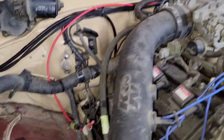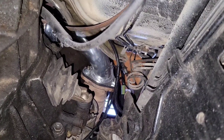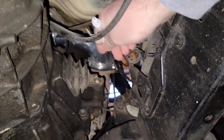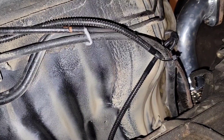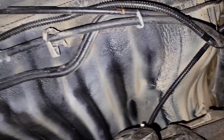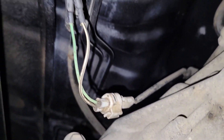I'll work on getting the transfer case and transmission hooked up. Down here at the bottom you can see where the transfer case wires come from the top. I'll route it over there — look at that, snapped right in. Second one we gotta get hooked up is the t-case for when you're in four-wheel drive, and that connection is right there. The t-case one I had to splice in — I found a connection off the old wiring harness and cut it off. If you read the instructions, it doesn't matter which color wire goes to which color wire on the harness.